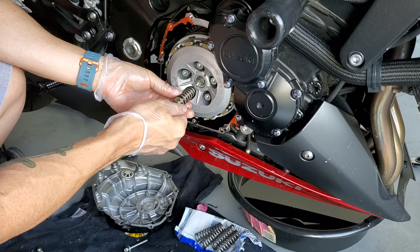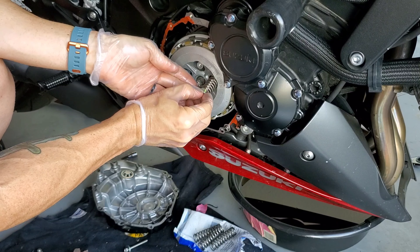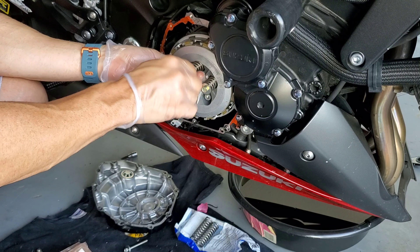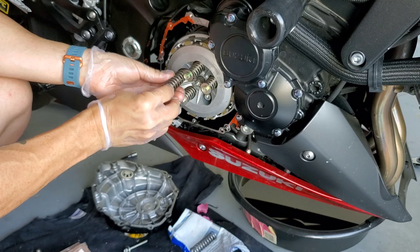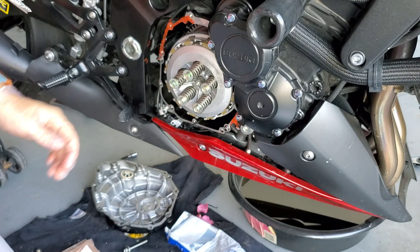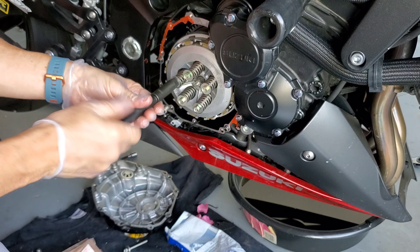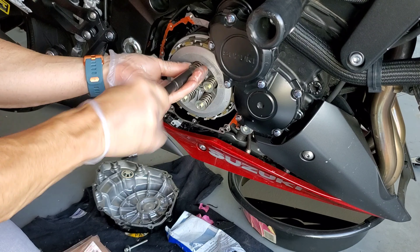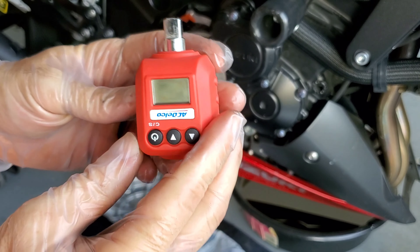First of all, I bought a digital torque meter — this one goes from five foot-pounds all the way to about 60, and for anything beyond 60 I'll use my normal click-type torque wrench. I also bought a set of five bolts just like these ones here, original and brand new from Suzuki, which is great. Halfway through I also decided to go with the original clutch but with heavy-duty springs.